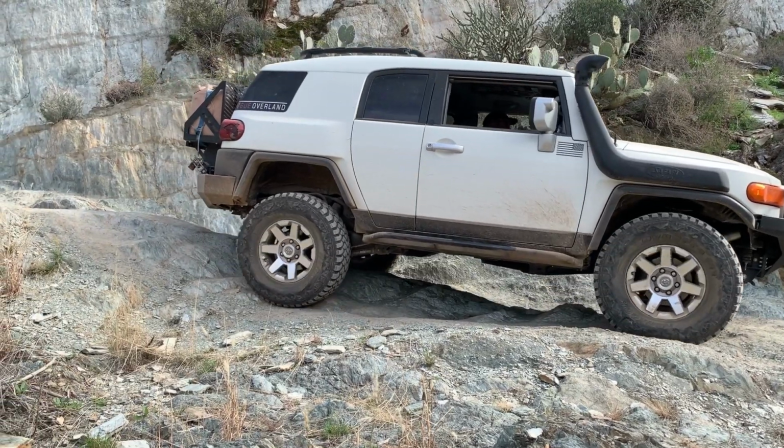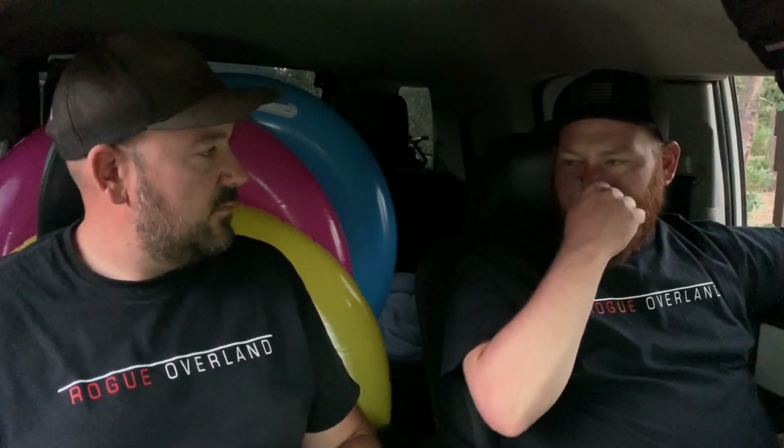Oh yeah, really well. And you custom welded the mounts on for that, or it's a kit? It came as a kit from AllPro. I'm not entirely sure on their offering still. I swooped that up right away. The mounts had to be welded on the axles, so we pulled the axles out, pulled the tubes, got it all cleaned up out of the way, and then the rest of it had the points bolt on. Then I cut the links a little bit shorter so it stays in the right spot. They do contact the extensions, but it's not really a factor. I also incorporated the bump stop straight into that.